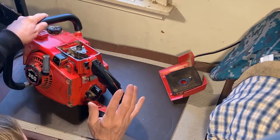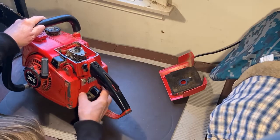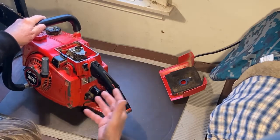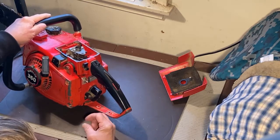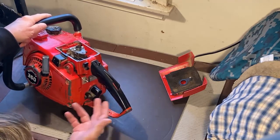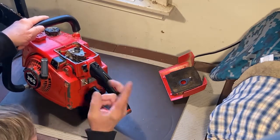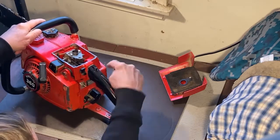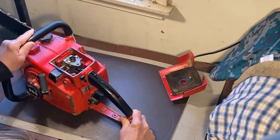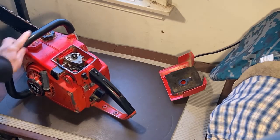Anyway, again, the advantage of not putting the screws in is that it makes the cover relatively easy to take on and off if you need to. But of course, now that I've added the grounding wire, I've solved the grounding issue. But I just wanted to add that it's possible that the lack of those 2 screws possibly contributed to this problem. Thanks.